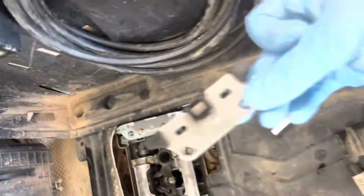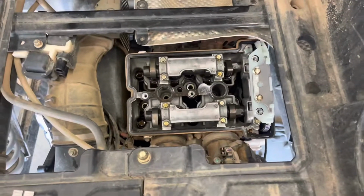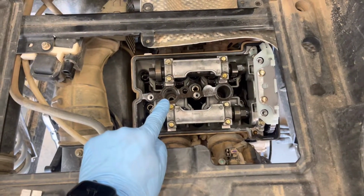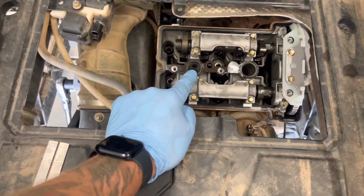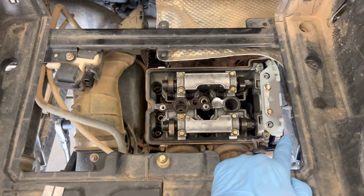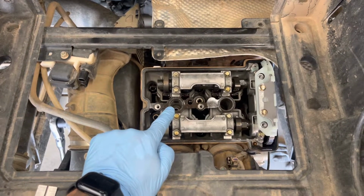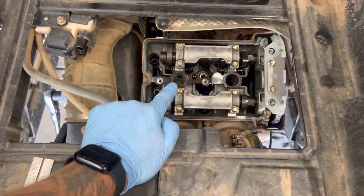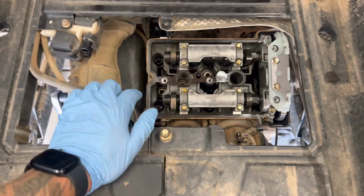They just redesigned it. All right, so after the crankshaft is at top dead center with number 1 cylinder, which is this one that's on the driver's side, you can verify that it's at top dead center by making sure that that mark on the crankshaft is at I and verifying that the cylinder is all the way up. So I did that with the camera. I just stuck an inspection camera in there, made sure the cylinder is all the way up.